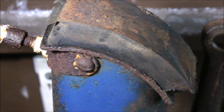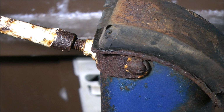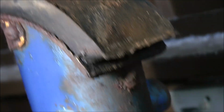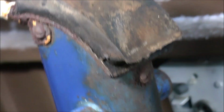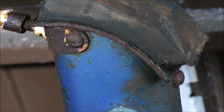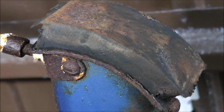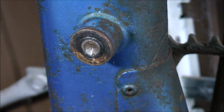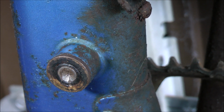That screw also attaches the brace for the rear part of the frame and carrier, but you've got that screw there, another on the other side, and bring some light around, one on the underneath there. Those are just self tappers, quite straightforward. The rear metal part there that you can see, all rusted, of the rubber has an oval section that goes into the frame. Also need to drill those out. That's going to be fun without a pillar drill, but I'll manage.